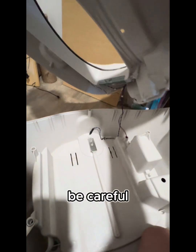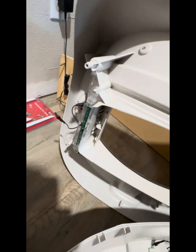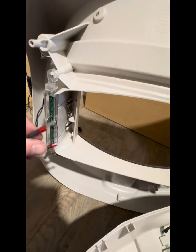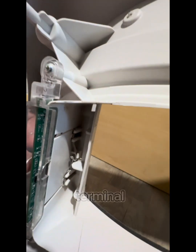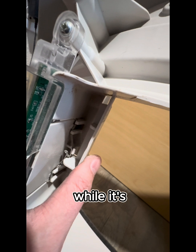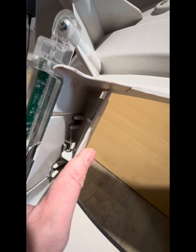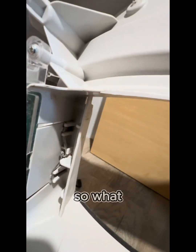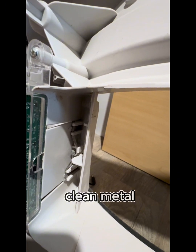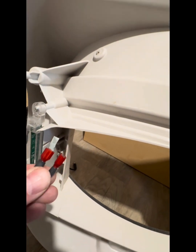Be careful, there is one wire that connects the top to the bottom. I had tried hard-wiring these two pinch detection wires together. They connect on the back, then there's a little terminal that connects there. If the cat gets stuck in there while it's rotating, it'll push right there and disconnect continuity between those two wires. I pulled those both out, cleaned them, sanded them down to make sure they had clean metal contact — and that didn't fix it. I hardwired it by putting a piece of metal in between the two. That didn't fix it either.